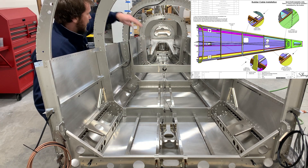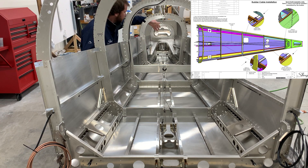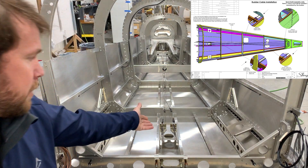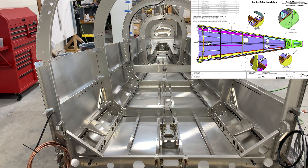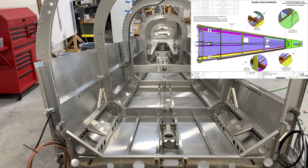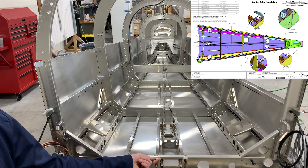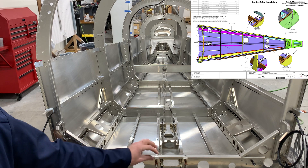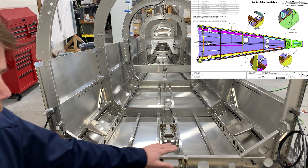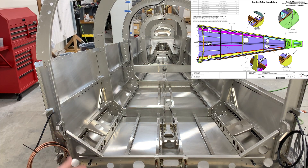Rivet your guides into place and run through the full installation. One thing to hold off on: don't tighten the cables down until final rigging. I also leave the riv nuts off until the rear and center fuselages are joined — that way you get more rigidity on the final mounting location of the tab, since there can be a little flex until the two fuselages are joined.